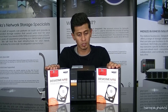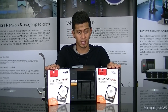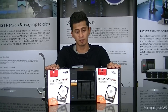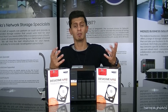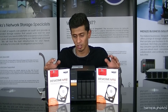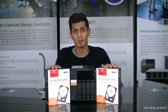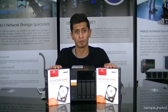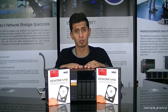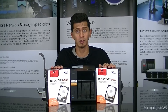Hitachi NAS drives are sitting next to it because we recommend them. This is a home and SOHO NAS — you don't need enterprise drives and you're not going to do anything enterprise-intensive on this box. HGST NAS drives are 7200rpm spinning drives, not like other brands which are 5400 or 5900rpm. So you get good performance from the drive without breaking the bank like enterprise drives would.